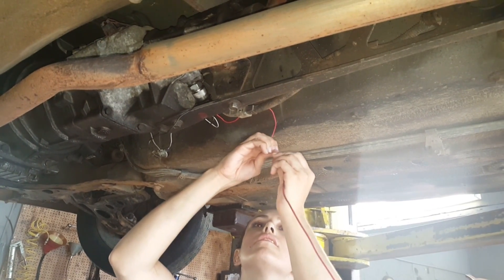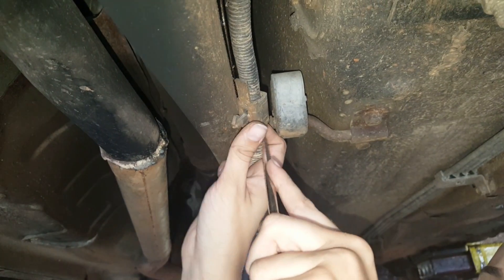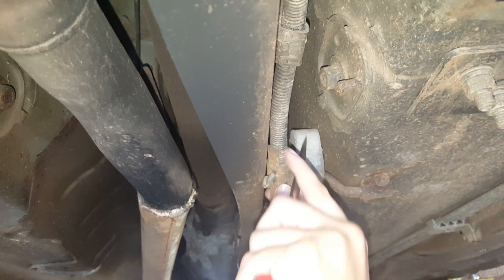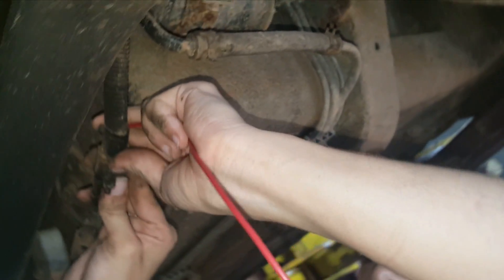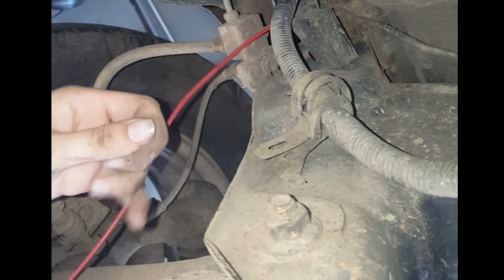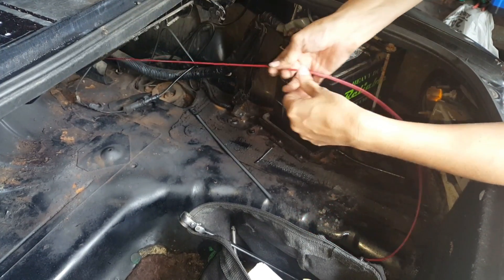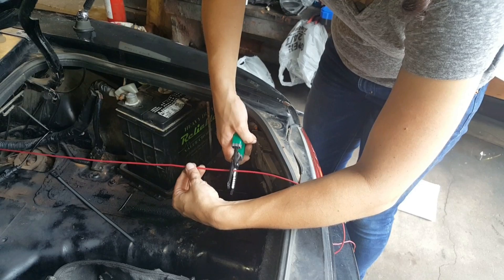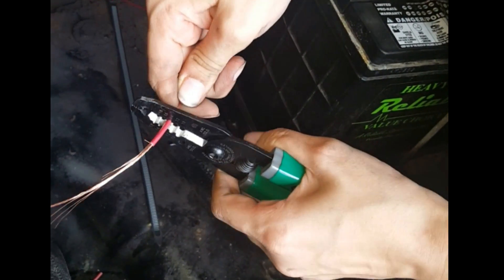Now we're going to connect the red wires together. The red wire is meant to give the speedo life by connecting it to the battery. Once connected, you can unlatch the PPF tabs and add the wire in to keep it off the ground and loose. For now, don't worry if the wire is entirely loose as we will adjust length in a second. In order to connect the red wire to the battery, we will have to cut into the main battery harness boot. Gently pull it through. Cut some, but not all of the extra length of the wire off. From there, you can crimp a new connector on. Add it to the positive terminal of the battery. Please remember to exercise proper caution when working around a battery.